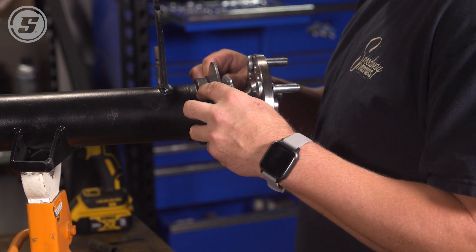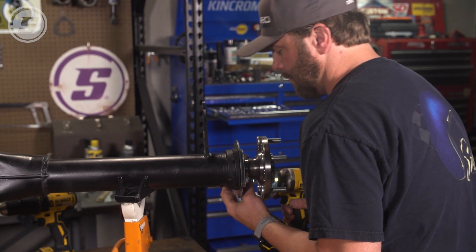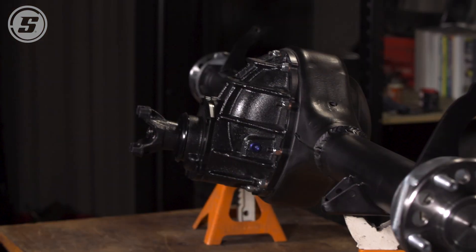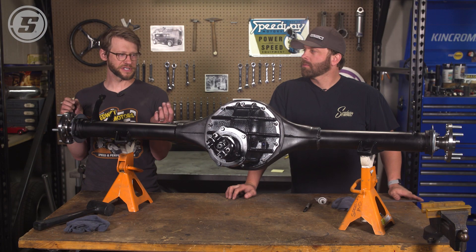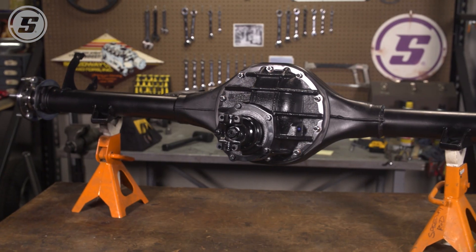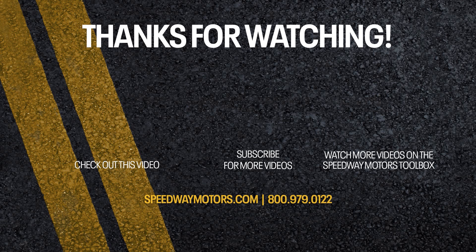Everything is good. We're going to put our clamping plates on now with our T-bolts and tighten them down, and then we'll be ready to move on. We tightened our clamps down, felt it seat the bearing and not bottom out on the pin in the center section, so we know our axle lengths are correct. And again, this is just one way to do it. It's easy when you already have the axles and can measure like we did. If you have the housing and need to order axles, you can just stick a tape in there, feel it bottom against the pin, measure out to the bearing surface, and extrapolate your axle length from there. Any questions at all, feel free to give us a call, and thanks for watching.